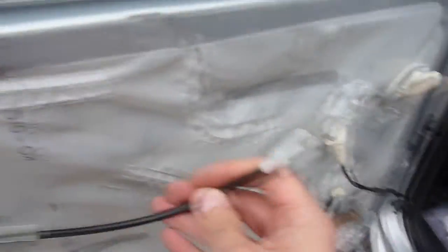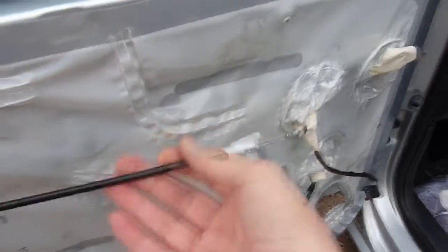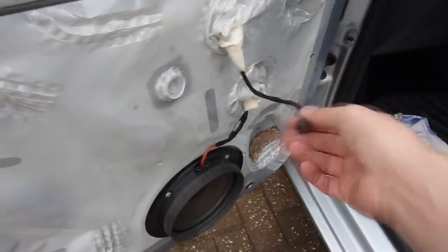The only awkward bit is the door cable - be careful but it is cable operated so it won't just snap. There's the electric window with different systems for that. You've got a few screws: a screw under here, screw there, screw there, another two there with one hidden under here and one here. Unscrew them and the door has clips around it - two main ones, this side and this side, and a few up here that you just gently pull off.